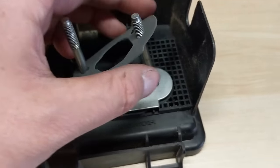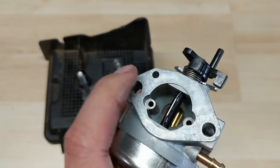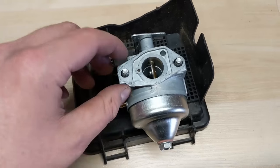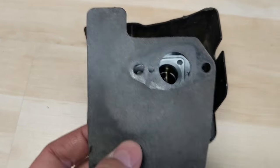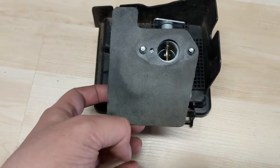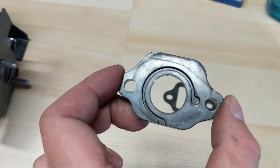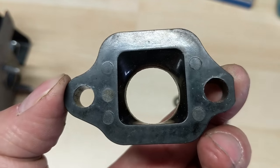So you've got the rubber gasket and the metal one — or in the case of other models, it's going to be the big plate — and then you're going to have another rubber gasket. Go ahead and put your carb on; that hole there lines up to the holes right there. You're not lining up this hole here, you're lining up that little ball bearing there. You want this piece to be long here and stick up there — this is your air dam.